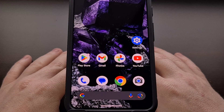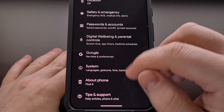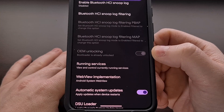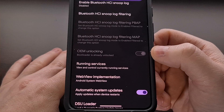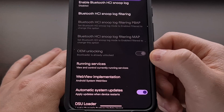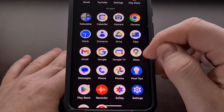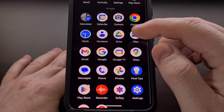With the phone booted back into Android, we can enable developer mode and then check the developer options menu. Scroll down a little bit to look for the OEM unlocking option, and we can confirm that the bootloader has been unlocked since this toggle is grayed out and we are told that the bootloader is already unlocked. So if you ran into any issues during this process, please leave a comment down below. I can't promise that I'll be able to answer everyone, but I will certainly help out when I'm able to.